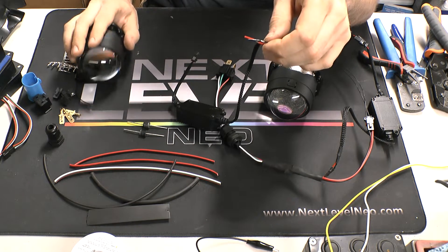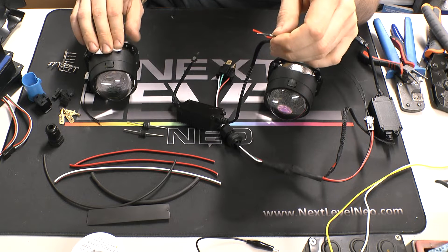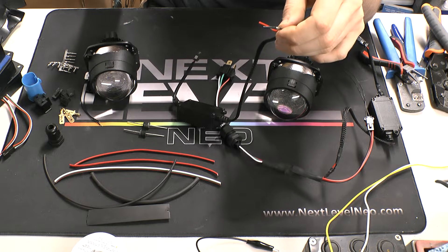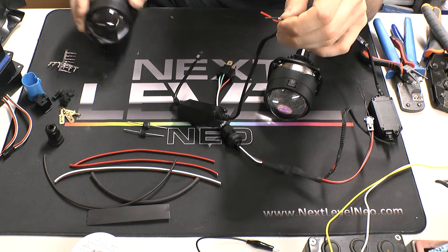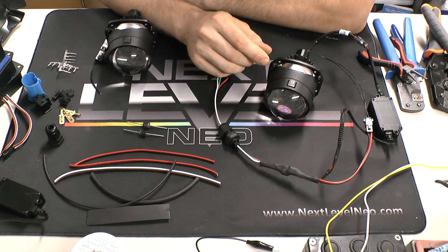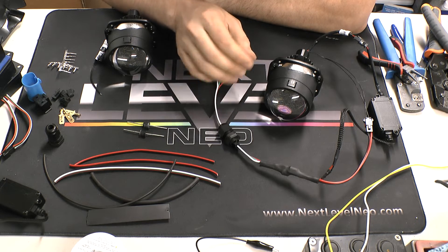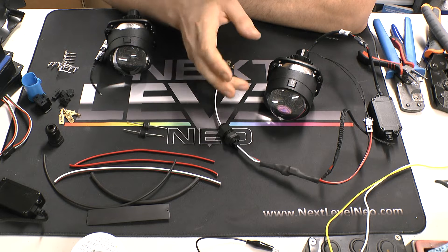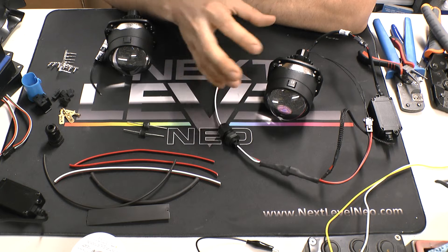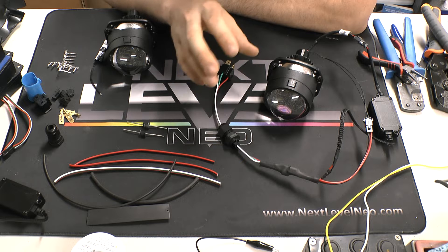While it will actuate the little flapper inside the solenoid to open up the projector, it will turn off the LED. The most common workaround for this is usually some kind of a harness that you can get from somebody like Morimoto, which will tie in with the system. They'll add a couple grounds. They're usually meant for HID so they're a little bit beefier, and it adds a whole lot of wiring and complication to the build itself. There is a workaround for that, especially with LEDs.